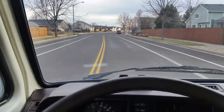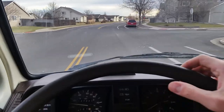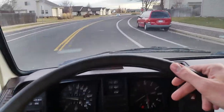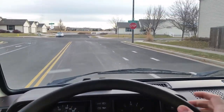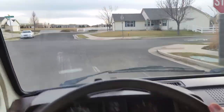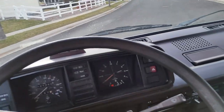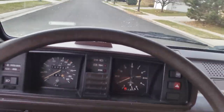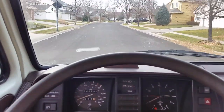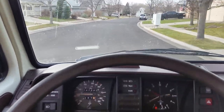So when that failed, it locked it in the closed position, and that would be its heat up position, so that the engine can get up to temperature quickly. But if it doesn't ever open, then once it's up to temperature, it just keeps on heating up because it doesn't allow more air to come in and keep it cool. So they had overheated the engine and just basically destroyed it from top to bottom.